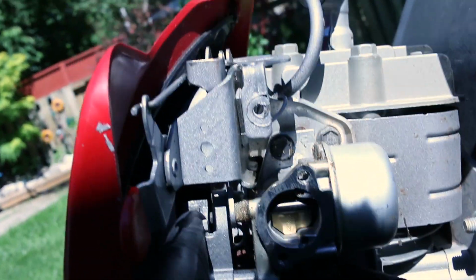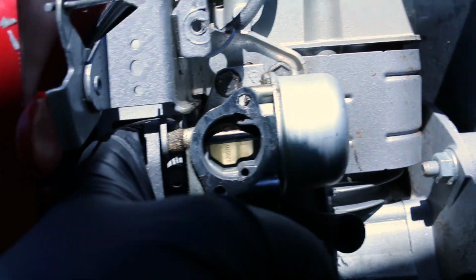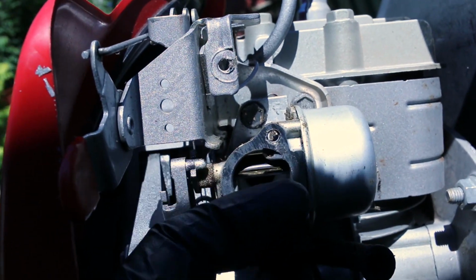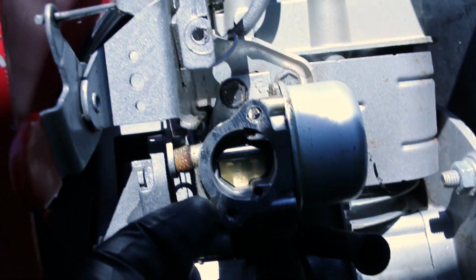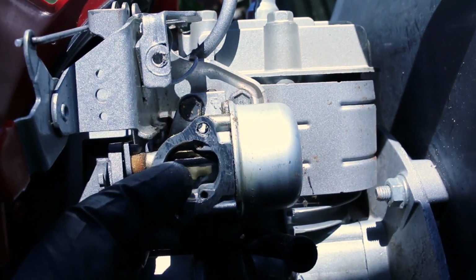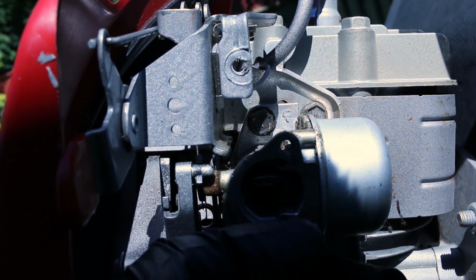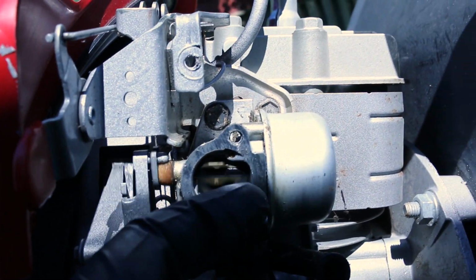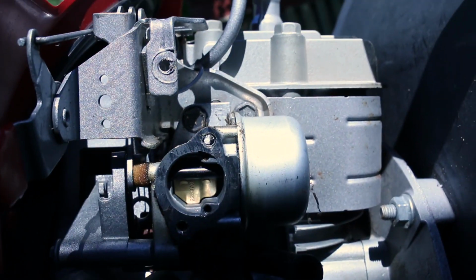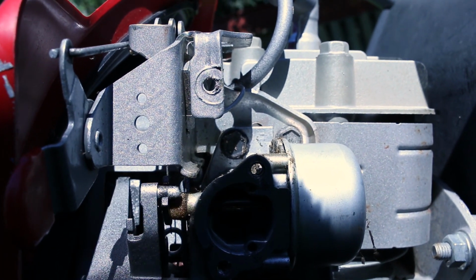Alright, I think I'm going to revise what I think of this. I think it is like a normal engine. That secondary plate back there is our throttle plate like any other. This thing's not an alien. And this governor system is strictly for this choke plate, and it's like any other. It makes much more sense that when the choke plate closes, you draw from your main discharge jet, just due to the increased vacuum on your jet. So we may have a low speed jet problem. Not seeing anything adjustable, or yeah, I don't know, but she's got to come apart.